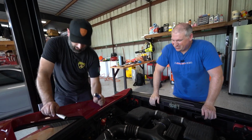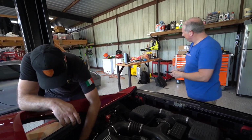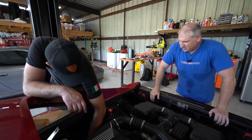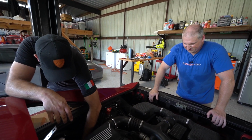The thing I've been told by old timers on cars about dielectric grease is that most people don't know what they're doing and don't know how to use stuff properly. You put it in and you don't do it right, so moisture gets in there anyway, and now the dielectric grease makes sure the moisture stays in there forever and rots it all out. It never gets a chance to evaporate and go away.